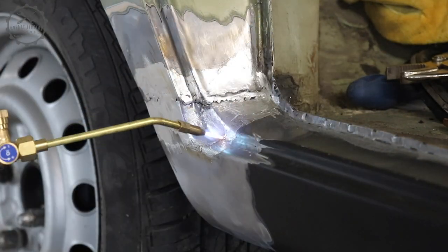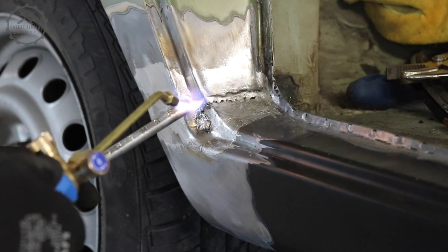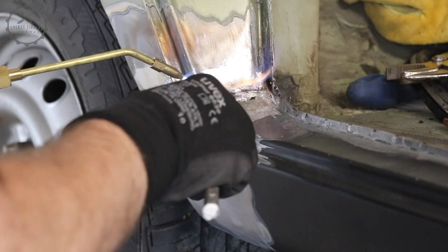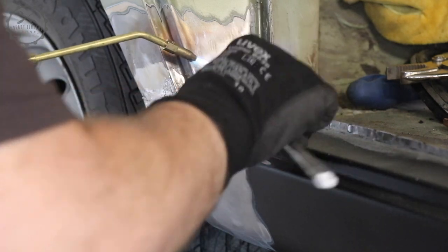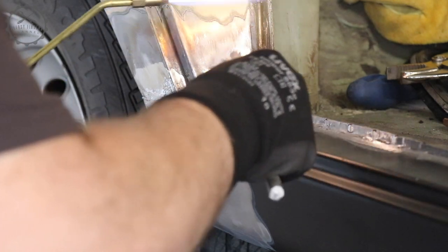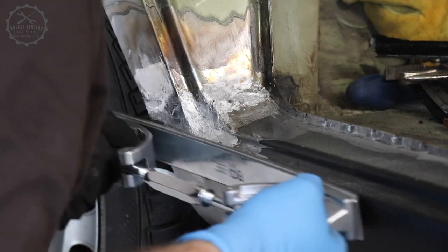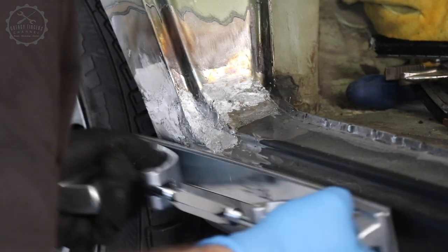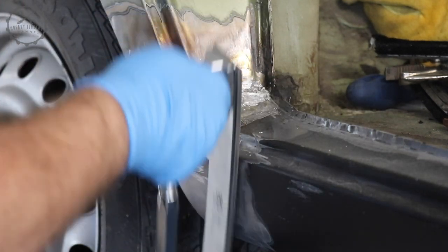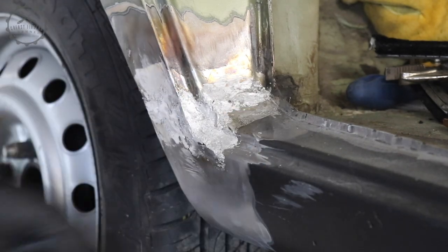I have a weak spot for old fashioned craftsman's techniques and I haven't practiced tin coating for a while. In the past this material consisted of a fair amount of lead, so it's actually called leading for a good reason. But we all know that lead has serious consequences for health if brought inside the body. Today you can get material consisting of 100% tin. I don't want to blame the material, but last time I did this was in the late 90s when it was common practice to use a lead-tin alloy, and I'm quite sure it worked much better back then. Anyway, though I need to do more research on available alloys and though a propane torch is much better suited than the either too hot or too sooty MAP gas flame I'm using here, I ended up with a satisfactory result.